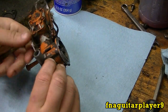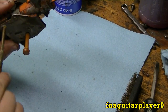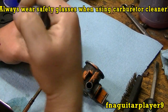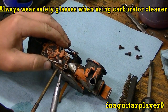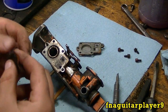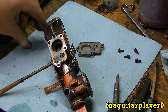I'm going to get ready to start taking the carburetor apart. I've already sprayed off the outside of it some. You notice your pickup screen here is kind of about half plugged up — I'm gonna try to clean it with the wire brush a little bit. Best to take them off, but I hate doing that because half the time you can't get them back on. The next thing I'm gonna do is take the diaphragm out of it — this basically acts kind of like a fuel pump. Take these four screws out here. Usually what wears out is these flappers, your valves here — that's usually what wears out. I think I got a new spring for it too; the spring was kind of rusty and that right there could cause a problem.